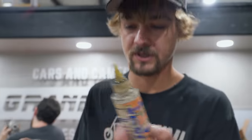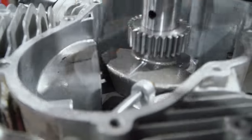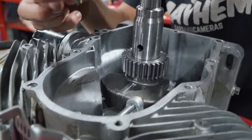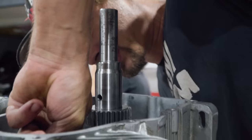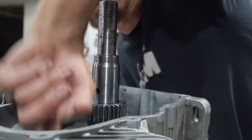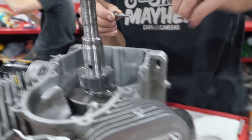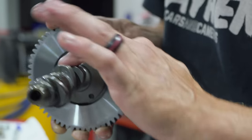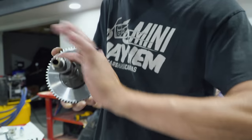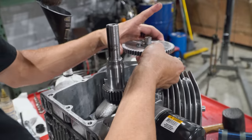I'm using Lucas-style assembly lube because it's more like oil — not too thick like grease. I especially like using it for the lifters because it makes them sticky and they stay in place. Luckily our engine is kind of laying down so they're not going to fall against the cam. We were having trouble getting the cam out earlier because the lifters were falling on top of the lobes. I put assembly lube on all the lobes because the engine has been cleaned — you do not want clean metal on metal in an engine, especially for the first startup.